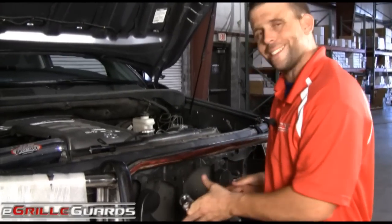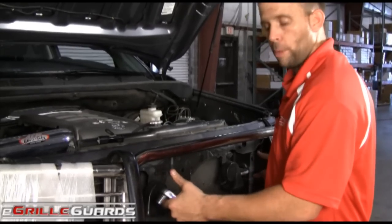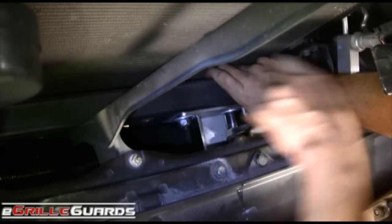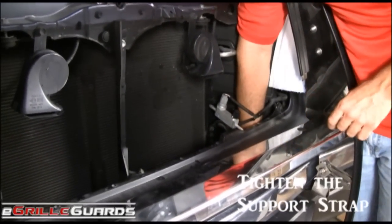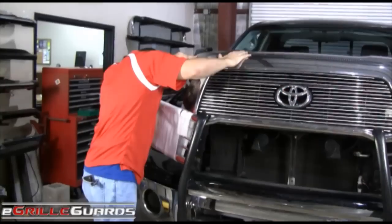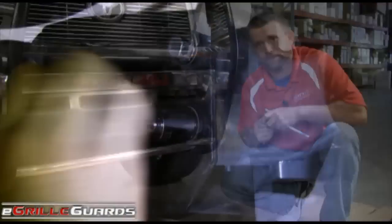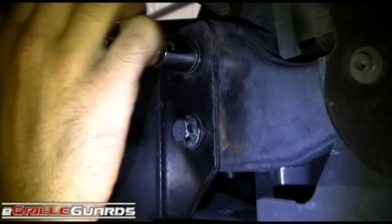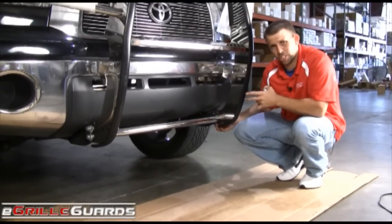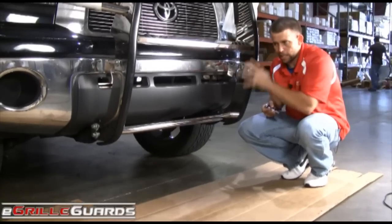Now that we've got the grill guard on, we're going to go back and actually start from the inside out on tightening everything up, starting with the main brackets on the inside, and then working with the two bolts on each end of the bracket that holds the support strap. When tightening this, you're going to be using a 16-millimeter socket or wrench. You can do it from the top or the bottom either way. Now we're going to start from the ground up, tightening the main factory bolts that hold the bracket to the frame. Then we're going to tighten up the bottom bolt on each side, which gives it a little tension so you can come up to the top, position the grill guard like you want it, and then tighten down the support straps to hold it in place, and then go back down and tighten up the other bolt.